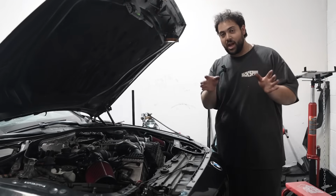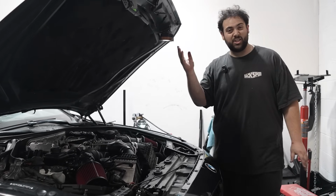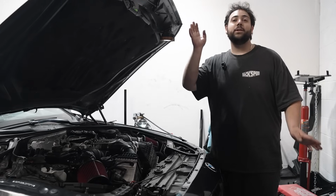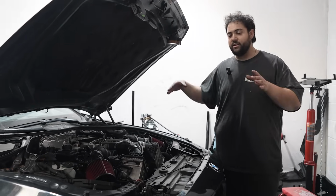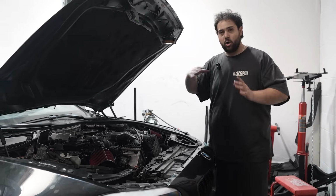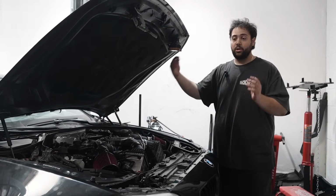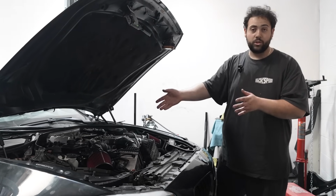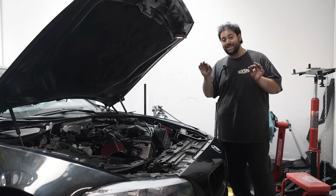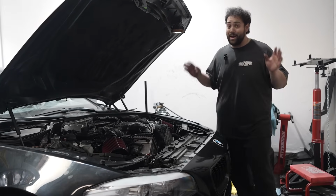Just so you guys can understand this, when you turn on a car cold start, you know how the RPMs go up maybe to like 2,000, and then maybe after like 30 seconds it drops down to idle? That's always when this thing would throw a code. Basically, in that 30 seconds that the car is revving high, is when it would trip the computer and it would say that's not getting enough oil pressure and that the exhaust cam is too far retarded via VANOS. If we can make it the entire cold start so that when it kicks down there are no codes, then we might have fixed it.